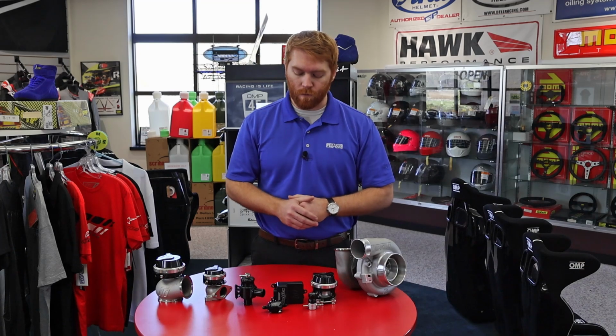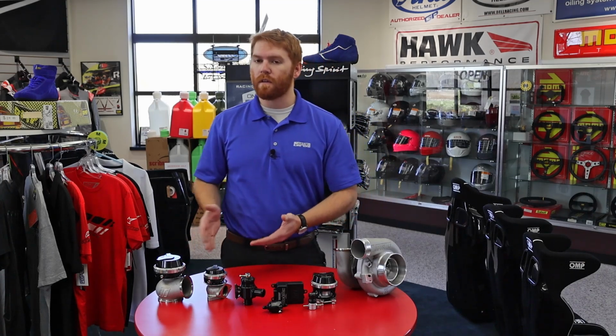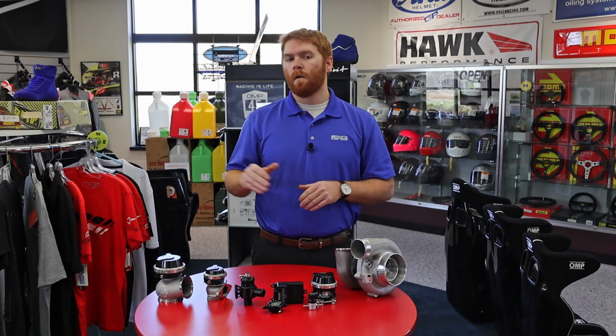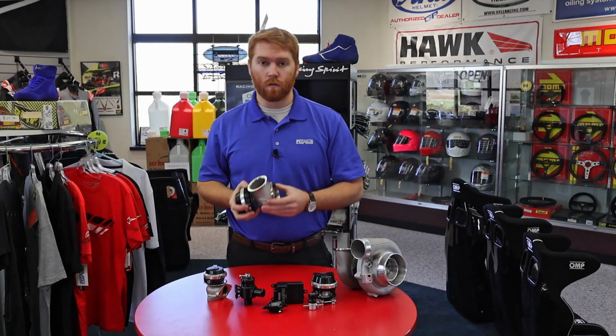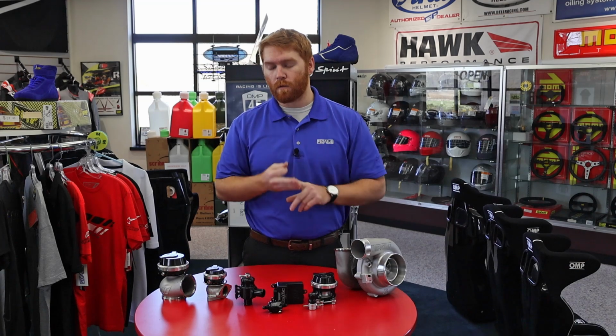And we're actually going to be talking a lot about boost control because that's pretty much the whole name of the game with turbo stuff. So using different size wastegates is the key thing, and making sure that you have an appropriately sized wastegate is very key to making sure that your system is going to function properly. If you have a wastegate that's too small, you're going to have boost creep. You're going to try and target 4 psi, 10 psi of boost, and you'll get 2 more than that, 3 more than that, 5 more than that. There are different things that can cause that boost creep, but as long as your plumbing is pretty good and you are making sure that the wastegate is actually getting priority, typically that's a good sign of the wastegate's just too small. There are companies out there that do have, they call them match bots, that will help you size a wastegate properly for the given turbo, the given engine, and how much boost you're trying to run.